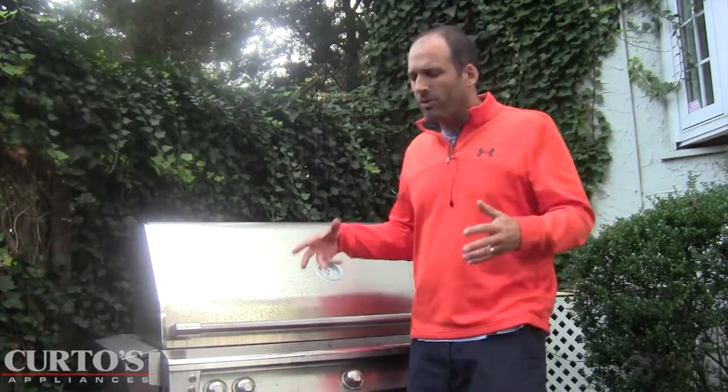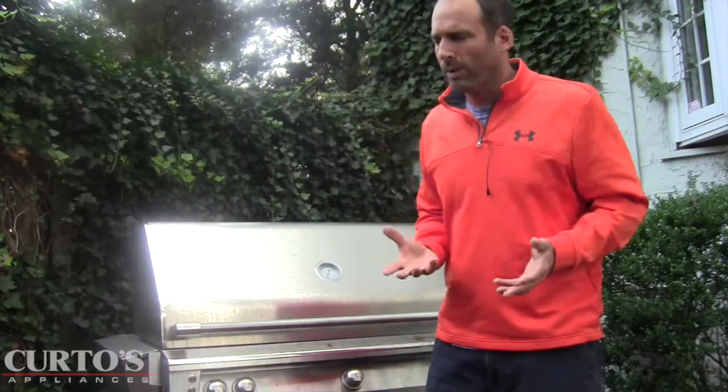There's no reason to add more burners to the grill. More burners means more heat — it's going to get too hot, break the grill down, beat up on the firebox, and potentially ruin your food. Everything about the way this grill is designed goes back to the cooking system with those ceramic briquettes and the efficiency they bring to the table.